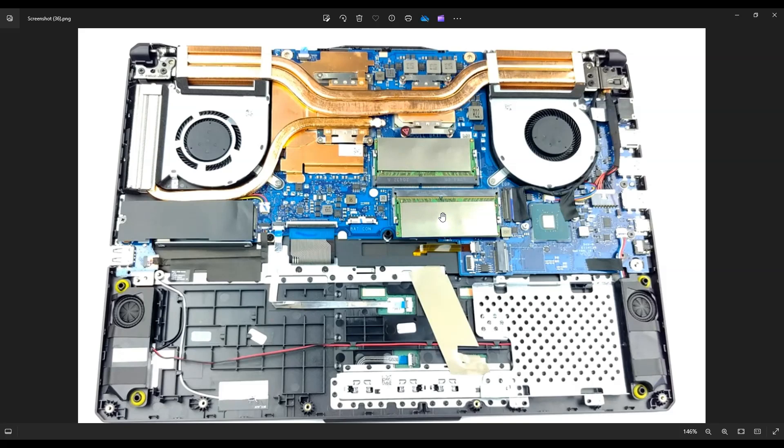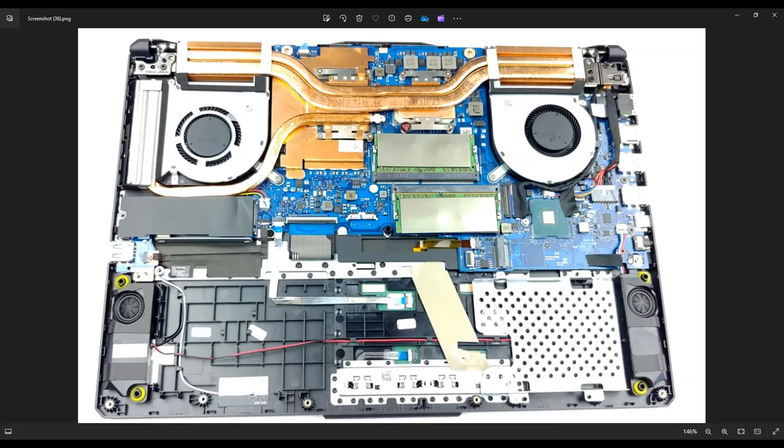As far as your hard drives and solid-state drives, there's a hard drive here. For those of you with the longer battery option, it'll wipe out this SATA 2.5 inch port, but some of you have a SATA 2.5 inch option here to add. Most of you will have these two solid-state drive M.2 ports — one to the left under your left fan, one to the right under your right fan. These are held in the exact same way. There's one tiny screw that holds down the solid-state drive stick. You would slide it into the port — kind of like RAM — press it down, and fasten it with that screw. There's a lot of storage capacity, potentially, in this laptop.